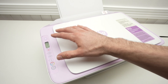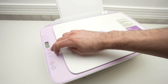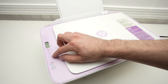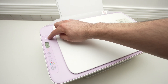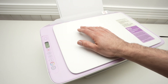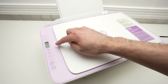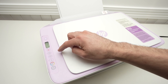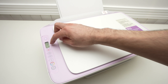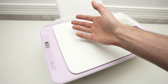But what if, in your case, this is not what you see? Then you need to press the Wi-Fi button and the X button here both at the same time for about 3 seconds, until you see the Wi-Fi button flashing and you may also see the power button flashing. This simply means it's in pairing mode and we're ready to start. If you're still having issues, the Wi-Fi may not be activated on your printer — press the Wi-Fi button once or twice until you see the Wi-Fi icon appearing on the screen, then press the Wi-Fi button and the X for 3 seconds to put it in pairing mode.